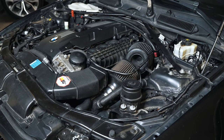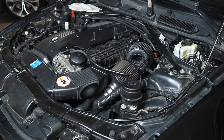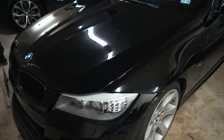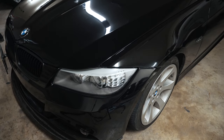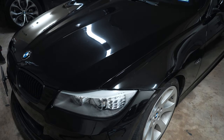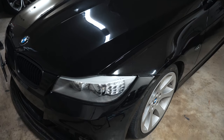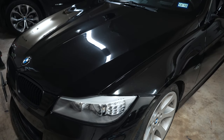It's running nice and smooth. Everything's normal — what you would expect. You can't really tell any difference under normal use. Just got back from a test drive — everything feels perfectly smooth and fine. No noises, nothing. The car doesn't have an updated tune at this point. There's a regulating valve inside the HPFP that will naturally bleed off excess pressure. But the reason you need to tell your tuner is to dial in your air fuel ratio as well as have that valve open more than 60% — they have to command it to open at least 80% to allow for the additional flow to be useful.